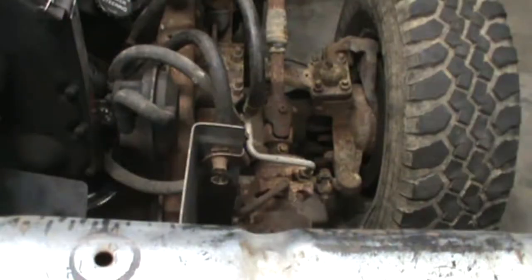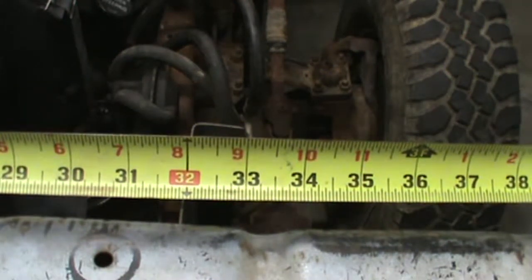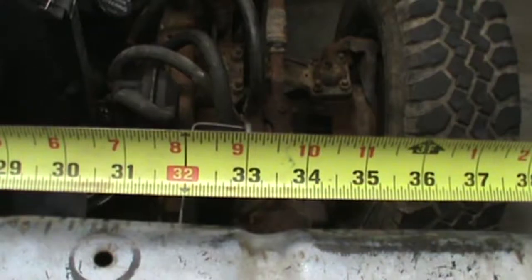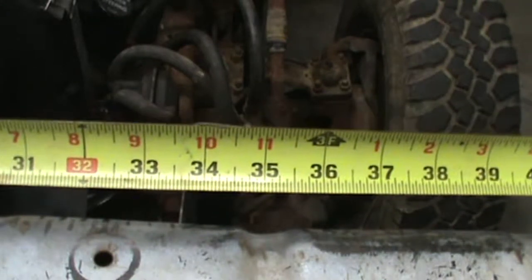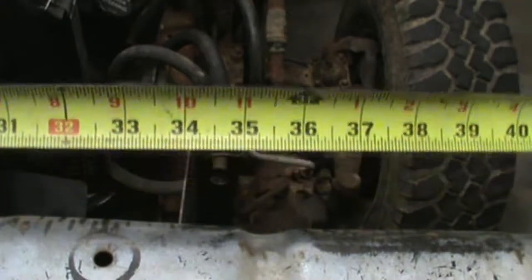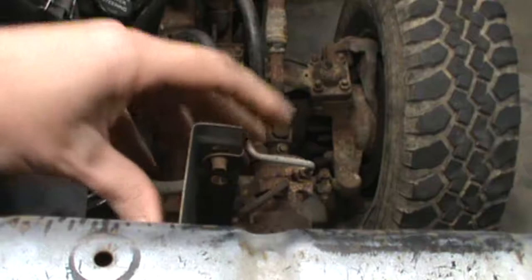However, I've run into a snag. As I was taking apart the truck, I went to measure the front grille support and noticed the measurements don't align with the radiator. The radiator support is 32 inches, and the Mishimoto radiator for a first-gen is 36 inches — so it's four inches too long. Even splitting the difference, we're looking at two inches on each side, meaning that whole bracket would basically have to be taken out to make the radiator fit.